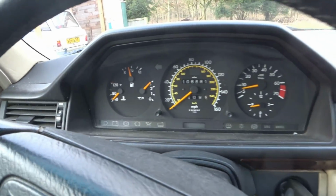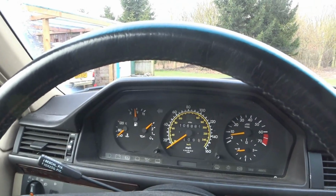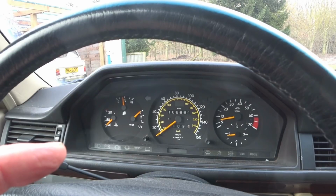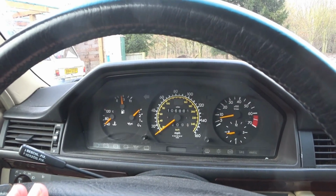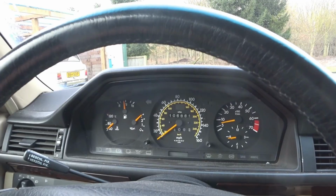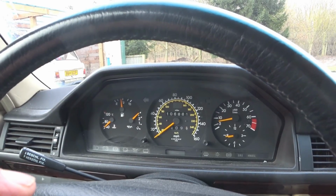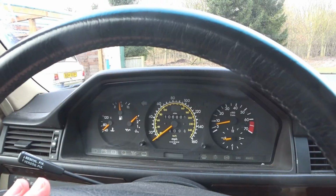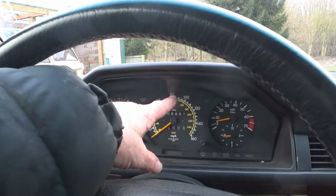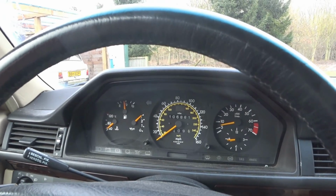Okay, so now there's no lights on there at all. And I'm on the grass. Let's put this into low. Now, this is icy, slippery grass. When I pull away, I'll rev it up and pull away, and one of the rear wheels, because it's only driving in the rear wheels, will slip, or both of them will slip, and immediately the sensors will sense that, and solenoids obviously will engage the prop shaft to drive the front wheels. To indicate this is happening, the yellow light will come on here in the middle, and it will be in 4-wheel drive, and the car should be able to drive straight and well on this grass.